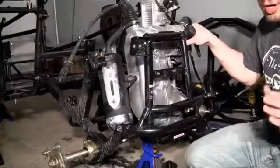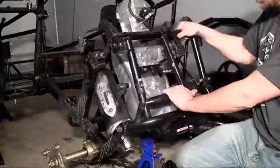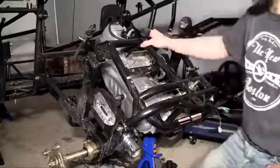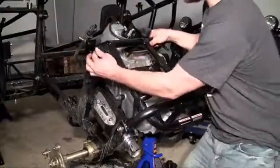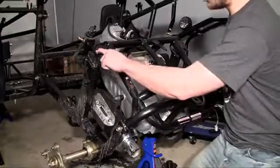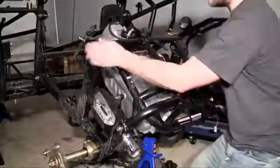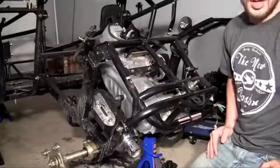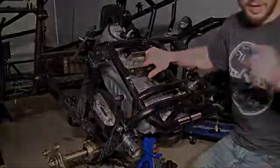Now if your engine is already upright, then go ahead and pat yourself on the back. You're ready to move on. But if you get one of these pivoting frames, and I really like this pivoting idea because it's really easy to pull your engine whenever you need to, then just go ahead and lower it into place. There are also two brackets, one right here and one right here. You just have to screw the nuts on these to make sure that your engine doesn't flip back up whenever you're driving or anything. Just go ahead and tighten those two secure brackets, and once you do that, you're ready to move on to the next step. So congratulations, your engine is now installed. I'll see you guys in the next video.